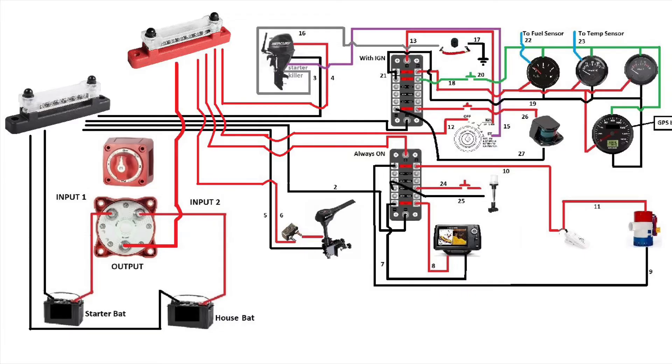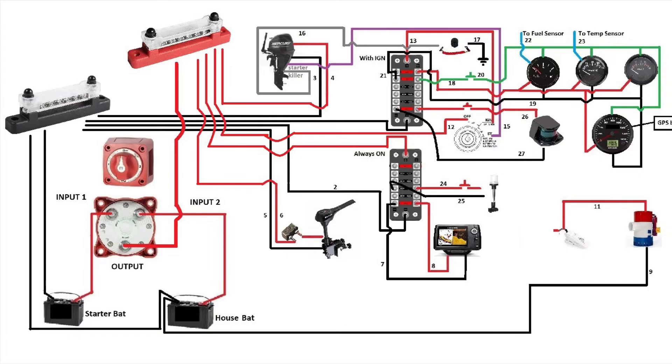Your pump won't start — it needs to be connected directly to your battery. Let's disconnect the negative of the pump from the always-on fuse box, and let's disconnect the positive of the pump from the always-on fuse box. Now we're ready to connect it to the house battery. We'll take the negative of the pump and bring it to the negative of the house battery, and bring the positive of the water pump to the positive of the house battery.